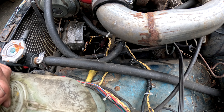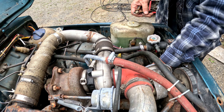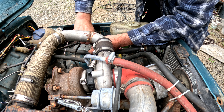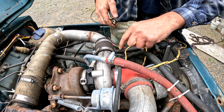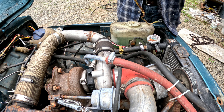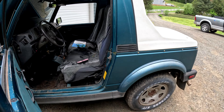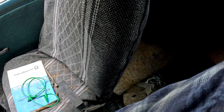That's the charge wire, so I'll just disconnect that for now and run it without an alternator. Clearly something shorted out in the alternator, but this was going to have to go anyway — I'm just going to clip it off here. There we go, this goes in the garbage. Our arcing and sparking is gone. I can hear a fuel pump running under the back seat there.